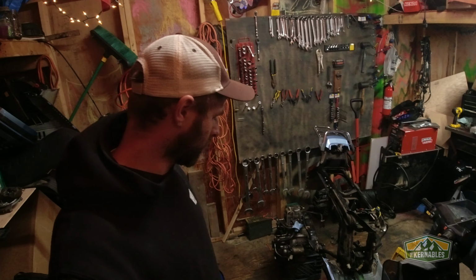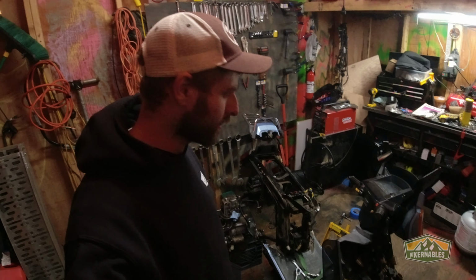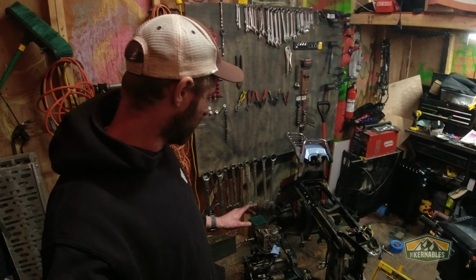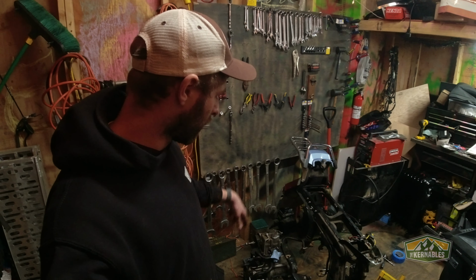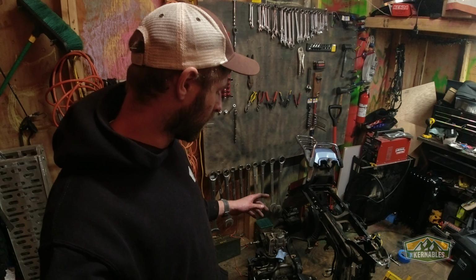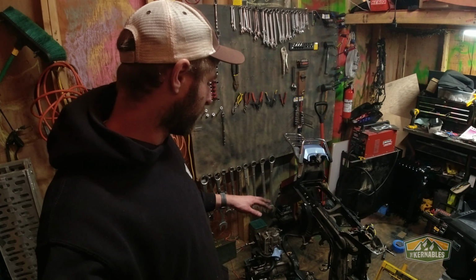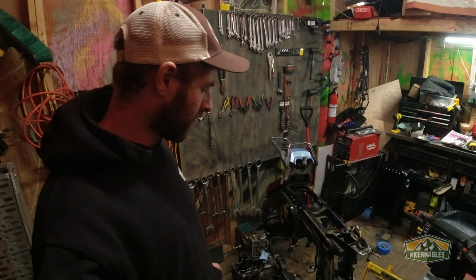Alright, well, this video didn't completely go as expected. Got a lot of change of plans, a lot of stuff to think about now as far as the scooter goes. But in the next video, I'll be tearing into the engine, we'll be going over cleaning it all, and I'm going to open up the variator. Probably clean it, because I guarantee it's probably full of grease. Replace the sliders, and I got to get the clutch out to send it off to get it reworked.